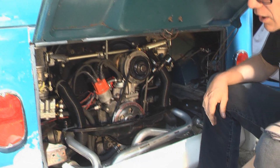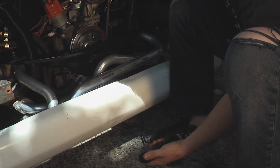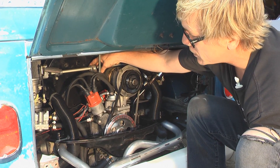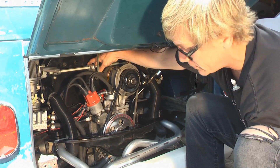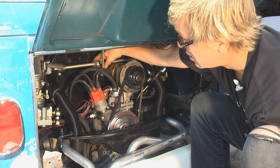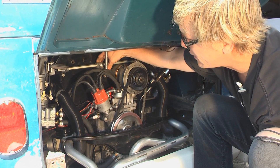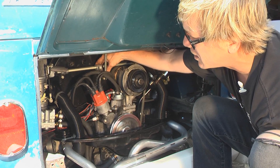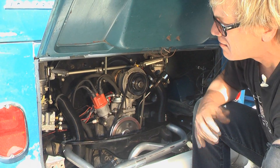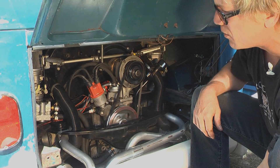Now you're going to use your remote starter — as soon as the motor starts up you're going to want to take your finger off of it, because this is engaging the starter. But once it is running, get in here and try to get the carburetors opened up manually to keep the engine running. Hopefully it'll be running and then after we've got it running, we know that our next step is to go ahead and balance the carburetors. It looks like the carburetors need to be balanced a little bit — idling a little bit low — but our original settings were really good to get us close. With MSD ignition and brand new carbs, all set up really nicely, they tend to start up pretty easily. The timing was already set, so that was good.